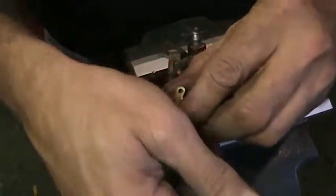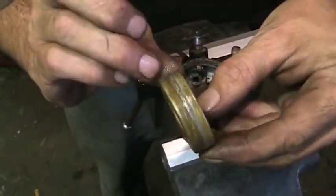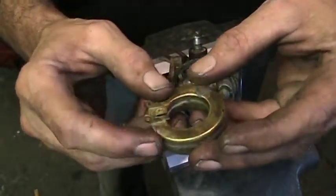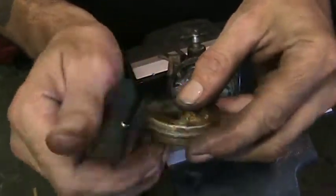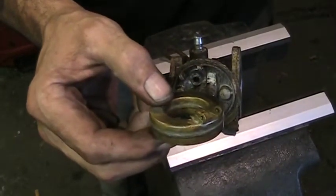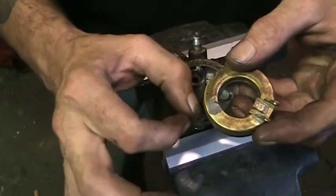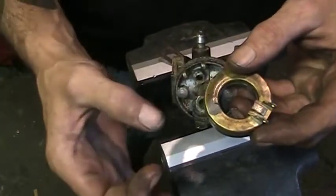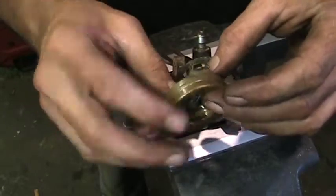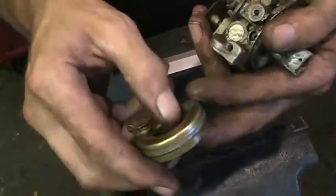I've done it before. Actually, I had good success doing it before. And I'll shoot a video of that just because it's interesting. I can't see any cracks, but in the little video on this, I will show you how to find them. Easiest way to find them, easiest way to fix them. The last one I did was actually on an old 89 Ford E350 motorhome, and it had like a barrel shaped float. It was like a cylinder, and it snapped into a little ring on the sending unit in the fuel tank, and it had a bunch of cracks in it. So I brushed it off, cleaned it up. I did a bunch of soldering, testing, solder and test, solder and test, and then actually it worked pretty good.